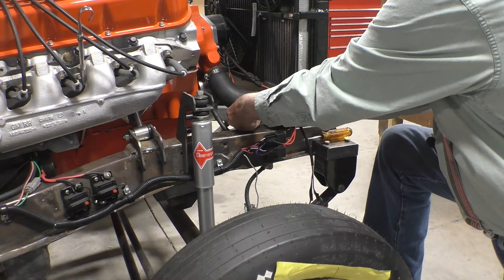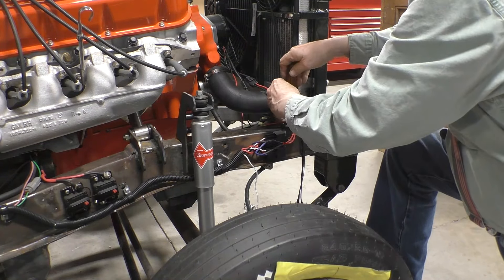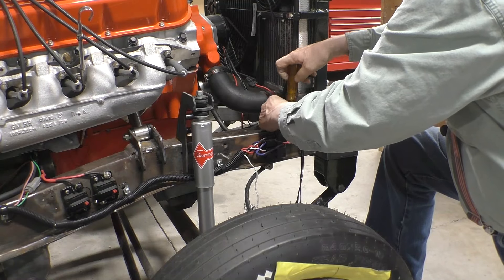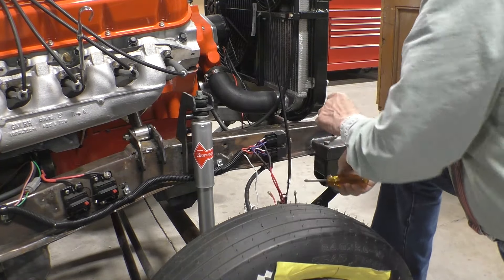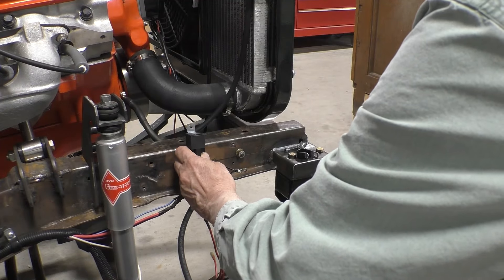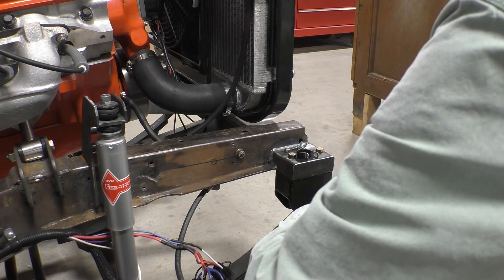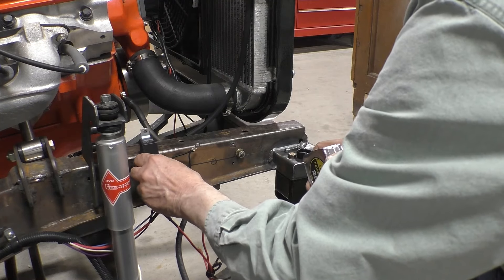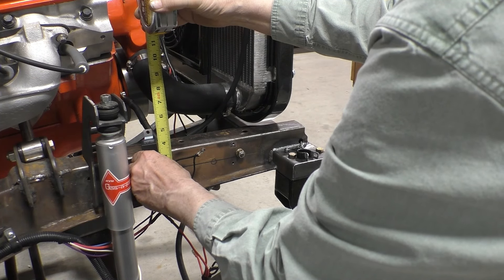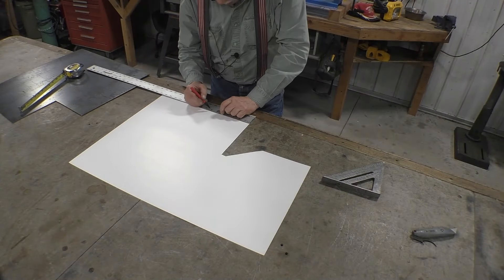We'll disconnect and take all the fasteners out so that we can redo this mess, and then put the third relay right next to it. I want to be able to space them out fairly nicely. We have space for seven inches long, and if we mount the relay this way we've got plenty of room to run the wires underneath — that's five inches to the top of the fastener. We'll go six inches tall, so six by seven just to be sure that's the size we want.